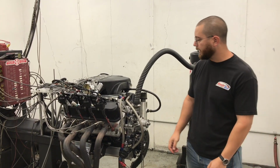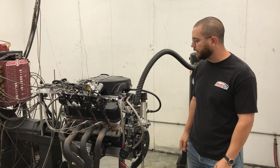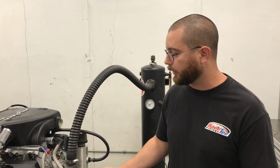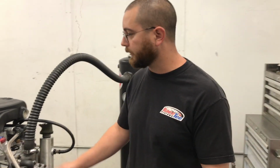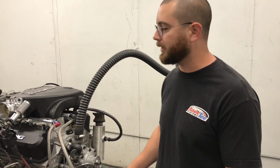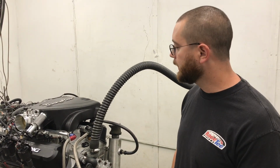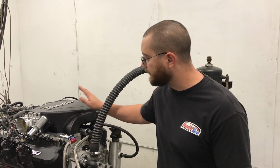This time it's a 347E. So this is a very mild cam. It's about 10.2 to 1 compression, 347. Cam duration is just over 210, so that's not much bigger than stock. It has a bit more lift, it's over 500 lift. And this one has the TFS intake.